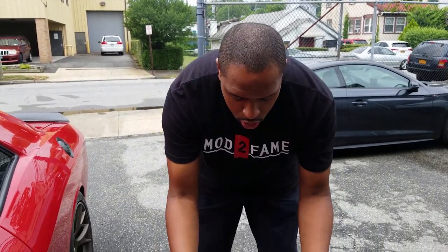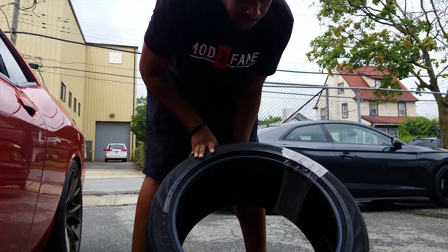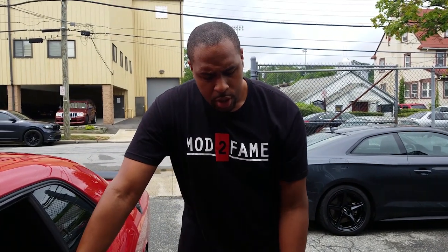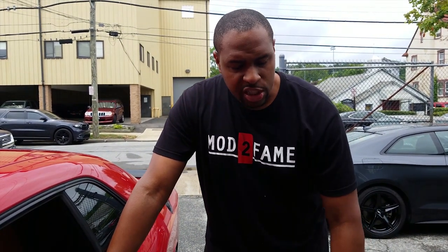But one thing that I really, really like about these tires is, not only is this a 315, right? So this is the big dog. We're putting 315s on Cheapokitty. To be exact, 315/35/20. So not only is it a super wide tire, but one thing that I noticed is that these tires actually run a little over spec. For example, I have the same tire on the Corvette where I'm running a 295. I had 305s on the Corvette before, and these in 295 were bigger, they were wider. So these 315s are more like 325s. So that's why they look so freaking wide.